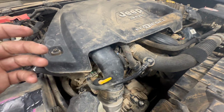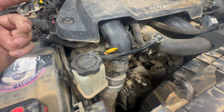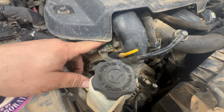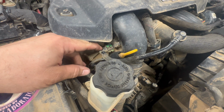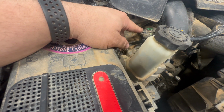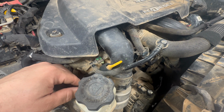And then just looking over, checking the bolt tightness on there, checking hoses, this evap line right here was off. It was just barely on, it wasn't even clipped in. The security clips on here were undone. It was just hanging there, like no one pushed it back up and engaged the lock pins on it. This would have caused the evap leak, right? So stuff like that is just shoddy workmanship.